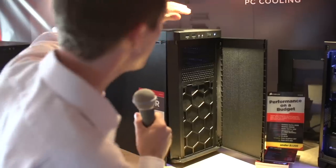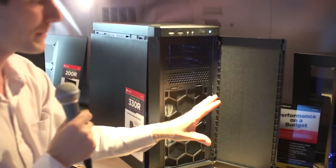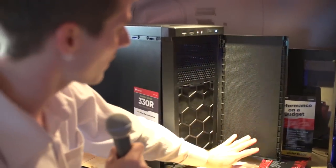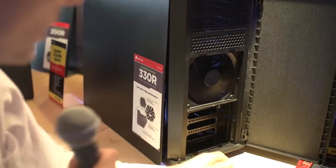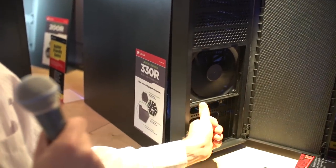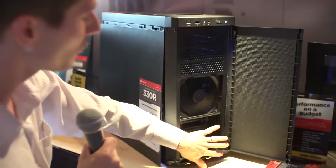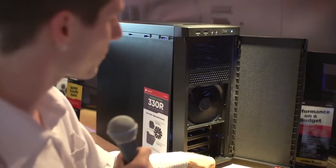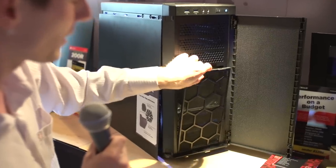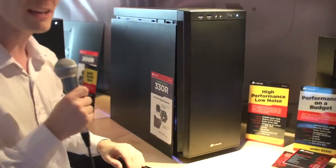On the inside, you can see this is a more noise-dampened, silence-optimized case. We've got a silent panel right here, and the same dual fan intakes. But check this out — this little duct Corsair found by adding this small piece of plastic helped the two front fans fight with each other less over the airflow, allowing them to draw more fresh air from outside. In their testing, they found that it improved graphics card temperatures by two to three degrees. It's amazing how those little tweaks can make all the difference.